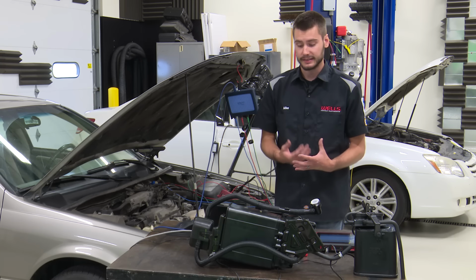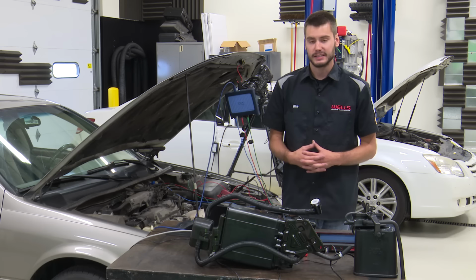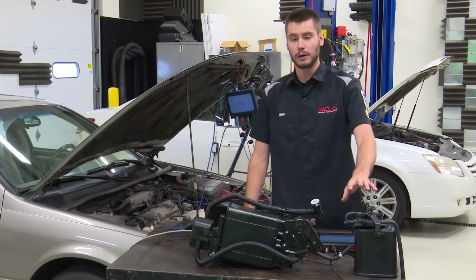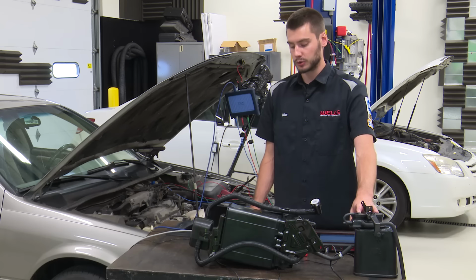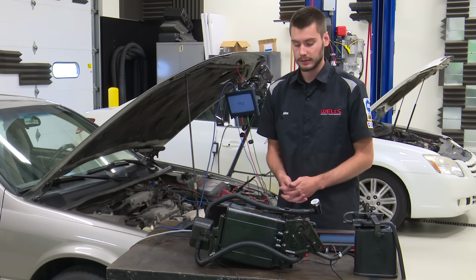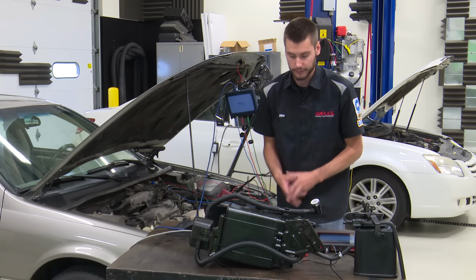Again, we're idling, the tank is sealed, the pressure should increase, but we should not have an extreme increase. It's possible you could see a P0451 code if you have a plugged up pressure relief bleed-off valve. If it's plugged up, you could potentially build a ton of pressure inside of there, but it's unlikely. Most commonly, this is just the rationality check for the fuel tank pressure sensor.